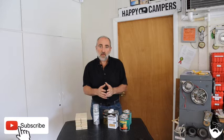No matter where you are in the United States, if you're cooking in your van and heating your van, you're introducing moisture. And wood is like mold food. Mold will grow very quickly in those close surfaces between the wood and your wall. If you don't have air circulation to keep your van nice and dry, you'll end up with mold growth. So it's very important to seal all the wood surfaces on your van.